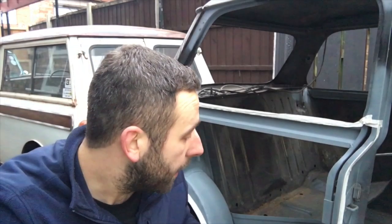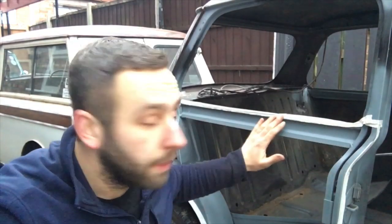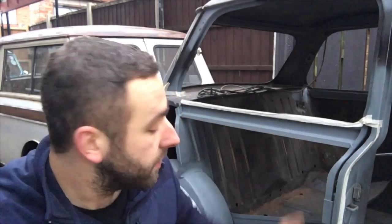I heated up the metal a little bit with a heat gun - I'll go and do it again, it just helps the paint adhere a little bit. All this is primed and ready to go. I've masked off where I'm going to weld because you want a clean surface to weld to. Whether I plug weld or spot weld this yet I don't know - really depends how impatient I become. Right now I really just want to get the car back together, so you might see an episode soon with me plug welding it, but for now I want to give it the best treatment possible and let's get some colour on it.